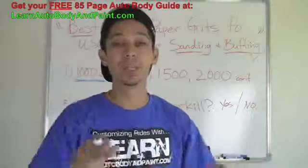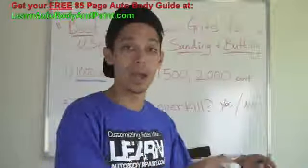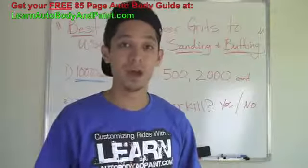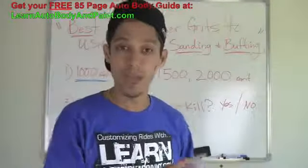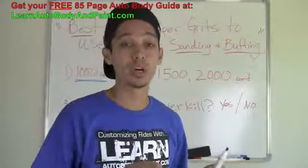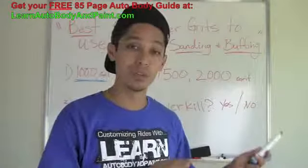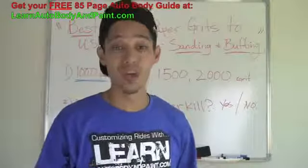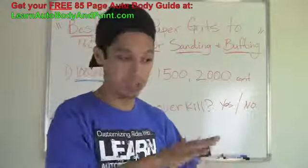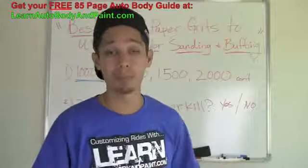I have complete step-by-step videos from the VIP training site on this whole process, both wet and dry sanding. I show you how it's done both ways. If you're experienced and confident with the DA and not afraid of messing up, dry sanding is a quick way to cut down all your panels. After that, I go over the whole thing and wash it down with 2000 grit wet sand, just to smooth out the 1500, and then you can buff on top of that.